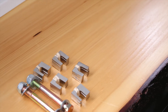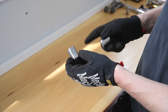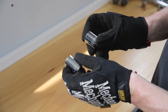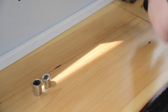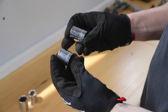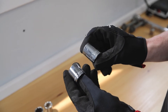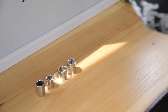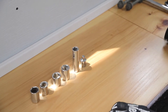Before we get started, let's go through every tool you need so you can get organized. The factory bolts are 21mm — both the bolt and the nut on the factory eccentric bolt are 21mm. You can use a wrench on one side and a ratchet on the other; I prefer to use two ratchets. Then 22mm is going to be for the new kit bolts you're installing to tighten those up. We also have a 17mm, which is simply to break the wheels free, as well as to act as a downsizer since I'm using a half-inch and three-eighths-inch drive.